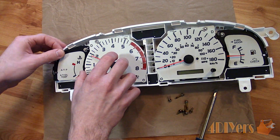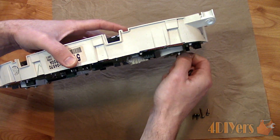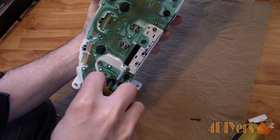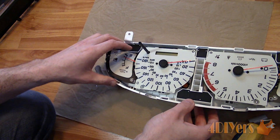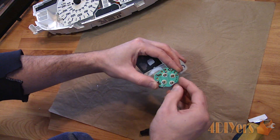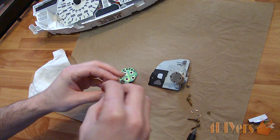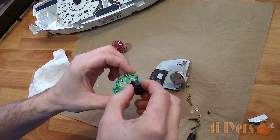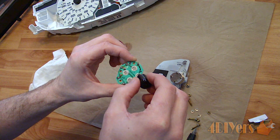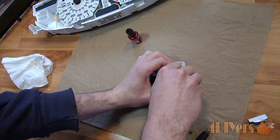Install and tighten those three Phillips screws on the rear. The same issue also applies to the fuel gauge — mine were in fact loose, however my fuel gauge was still functioning fine. The removal is the exact same: remove the three Phillips screws on the rear, bend out the edge of the speedometer face, then pull out the fuel gauge. Remove the nuts and washers, inspect for any corrosion, clean any corrosion as needed, then apply Deoxit D100L. Applying this protectant is a great preventative maintenance measure, especially for those who off-road their vehicles where you have a greater chance of exposing your truck to more moisture.